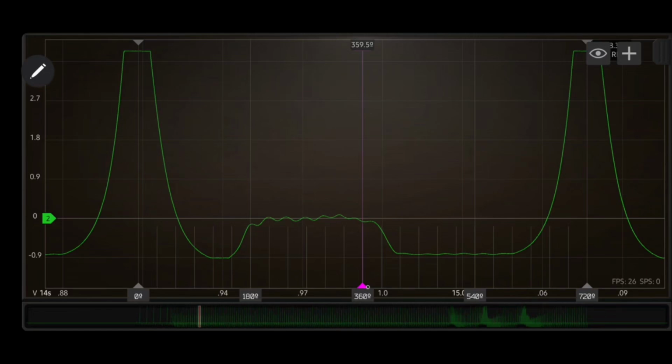Now, what also further confirms this is this bottom dead center line right here. You want it to be right at the top corner of this rising line here, or a little bit over halfway. So anywhere from in this area to this area is where you want that bottom dead center mark. So this is a little bit advanced. I would say maybe 5-6 degrees. So that's my feeling and opinion on that.